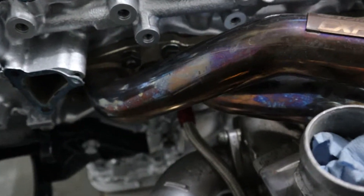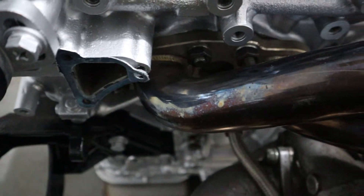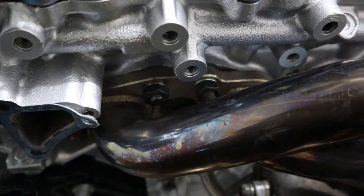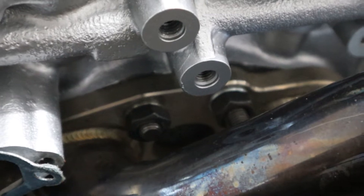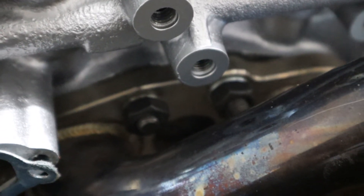I have a problem today. Just putting on my exhaust manifold, I'm trying to tighten up some bolts, but I got a bunch of bolts tight. If you see this bolt back here — see how this one is sticking out so much? It's not tightening up. As I'm turning this to tighten it, the bolt's pulling out, so that tells me something's wrong in here. The previous owner has tried to fix these studs — they probably went with a different style of thread repair technique.